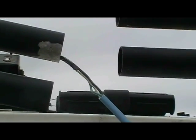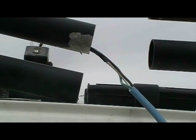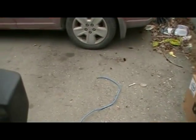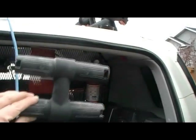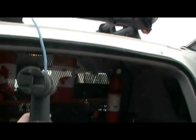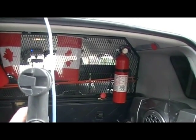I'm using an extension cord - not ideal for automotive wiring, but the gauge is right and this cord had a bad plug, and I've tested it for continuity. The reason I want to use it is for the extra insulation and protection, since it'll be inside the tube where I can't inspect it often. The challenge is the connector joining the two tubes - I'll need to drill holes to run the wire through it.